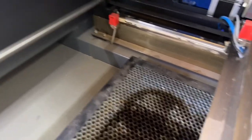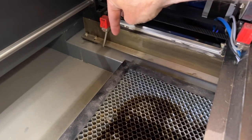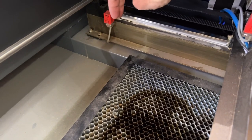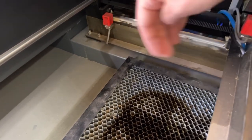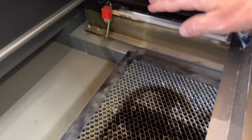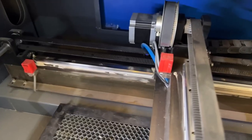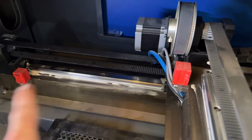The common cause for this kind of grinding is that one of these sensors has been hit — whether by the rail or something — and it's been pushed past where it should go. Now they are tipped, so they're not actually sensing the metal objects passing over them to stop the homing sequence and set the machine to zero. The first thing you need to check is that both of these sensors are standing upright.